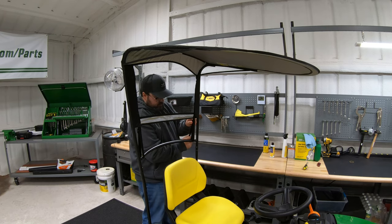Now let's talk about the dimensions of the mower, which is important when thinking about getting this in and out of your shed or storage space. This machine is going to be right at 70 inches long from front to rear. Height wise, the top of the seat is your tallest point at 44 inches. Width wise, even though this is a 48 inch cut deck, the width with the chute down and the bevel on each side of the deck is going to be 61 inches; with the chute raised you'll be around 52 inches. Weight wise, we're going to be about 468 pounds.